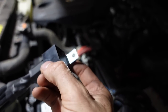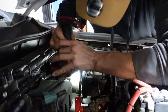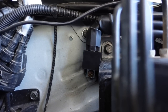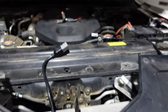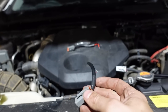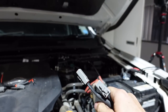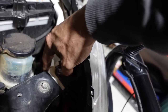I'm going to start off by mounting my relay, because that is the hub of all the wiring — everything runs to that. And there it is mounted just behind the ABS unit, nice and secure. The cables are running up behind it and leading over to the battery. The wires coming out of the back of the Steady Spotlights I've passed underneath my grill. Steady supplied unterminated cables in the back of the Deutsch connectors, basically allowing you to wire them into anything you want — but we won't need them for this install as we already have the pre-wired loom.